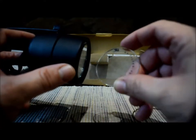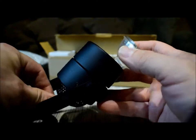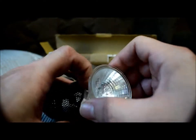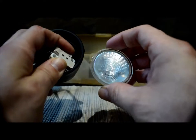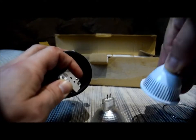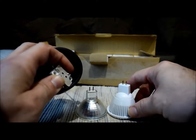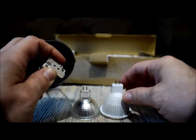Here's the lens that you remove. We're not going to reuse this because the new bulb has a different thickness — it's a little bit larger than the old halogen. You might have to wiggle the wire around and push the bulb out to get it to come out. You can see the size difference between the old bulb and the new one — quite a big difference, about a half inch in height.